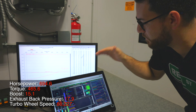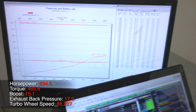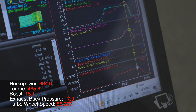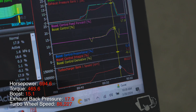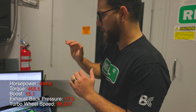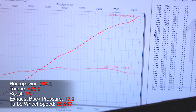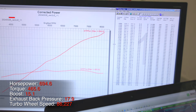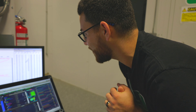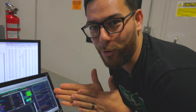That was pretty on the money. We were targeting 15 pounds of boost and you can see across the whole RPM range it's on that 15-pound target. Looking at the ECU software log for that pass, the turbo speed was at 86,227 RPM at its peak. So now we have a nice little baseline. Before we do any boost leaks or any holes in the charge pipe, we want to make sure we're comparing everything to these numbers. Peak power was 694 horsepower and 465 pounds of torque. Let's go ahead and start doing the first controlled leak.